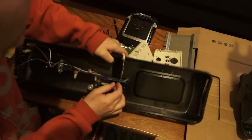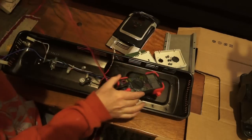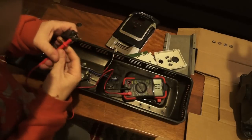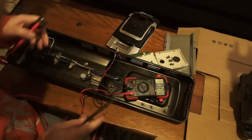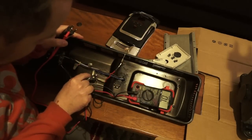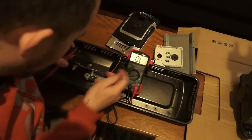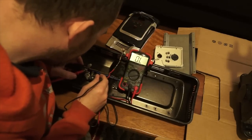I don't know what it is exactly, but what I was able to do was put the meter on the ohm setting. You get one end of your plug here — the right side is where the power is coming in — and the black probe. This is the switch that opens up if your radiator goes on its side, and that breaks the circuit. But what you can do is test. It says O-L, which I think just means it's open.